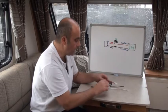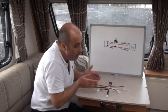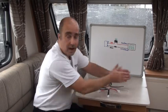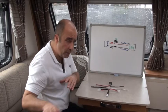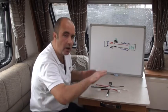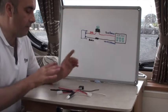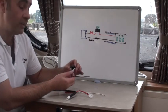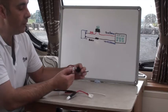The T connector has a red and a black — positive and minus — where the red goes into a single connection point and another red comes back out. The idea is we fit this in between very simply: power comes from the battery, leads down into the connection, goes to Flow, comes back up, and then leads out to the consumer unit. You'll notice the cables supplying the consumer unit are significantly thicker than the Flow cable — they need to carry power for all the other electronic devices.